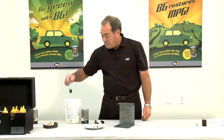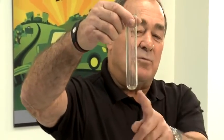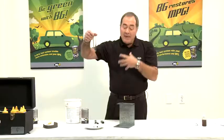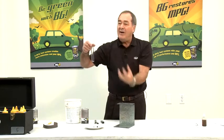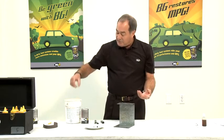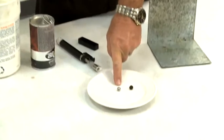If you want a completely clean engine, you'll be amazed at how clean your engine comes just by using 109. There's our engine. If you do this with 109 in a car, I recommend that you do a compression test first on the car. 109 will work on the hard deposits around the ring as well. So now we're going to clean up all the soft deposits and the hard deposits. There's my engine that's left inside — there's the bearing surfaces. Which one works best for you?